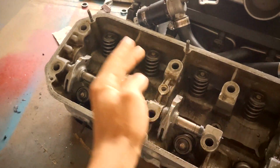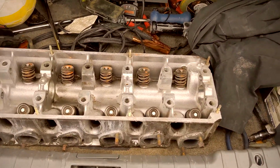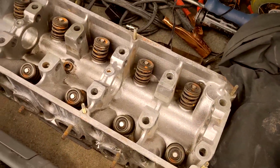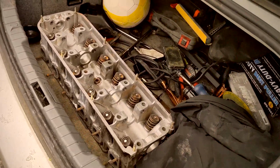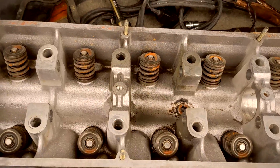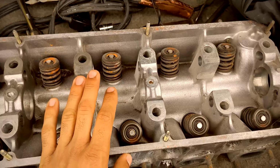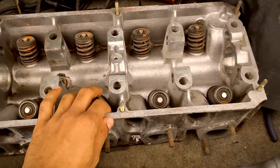Do not follow me when it comes to what I'm about to do here. I picked up my cylinder head from my uncle's shop. One of the guys that works up there has a machine shop at his house, so I had him resurface and clean my cylinder head. This is the good core that's going to be going in the black car here. So the cam and valve springs from the other head are going to be going in here, and also a few valves, because he did point out that a few valves are bent, so that won't be a problem. I'll just swap those out and we'll be good to go.